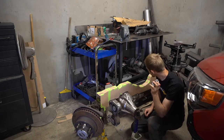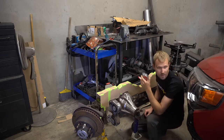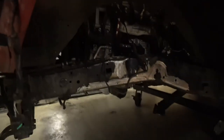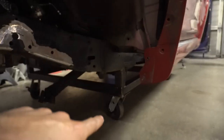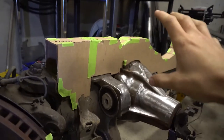See what happens. I'm gonna do some more trigonometry BS and see where the new Panhard mount is gonna be on this end. Because it's gonna be in the same spot on that side. But yeah, so I'm gonna do that. Exploring this route for a variety of reasons. One of which is going over the numbers and everything yesterday, I realized something that I hadn't realized. I forgot this part of the frickin' frame was higher than that. I was using the measurements off of that to the ground, a ride height, instead of that, which is a lot higher. Frickin' rookie move. That was definitely a rookie move. Killing me. Well, anyway, that's actually good news because it gives us a lot more room to work with, which is what we need right now.